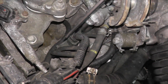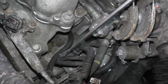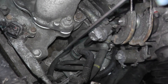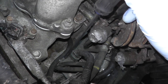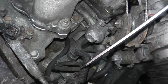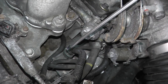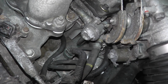The main function of this valve is that inside this metal body there's a plunger that moves back and forth depending on what the car's computer tells it to do. There are two sources for vacuum — either it goes to the throttle body or to the EGR valve, and that all depends on this plunger moving. If you're receiving code P1400, it's probable that the plunger has stopped working, but there could be other things — a split in the wire harness, or a blown fuse. Don't go out and purchase the sensor until you pinpoint exactly where the problem is.